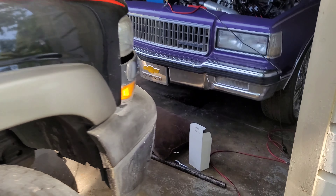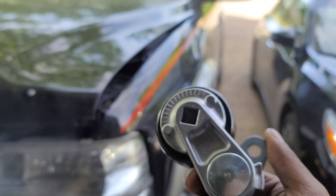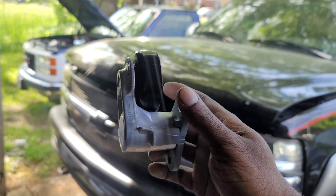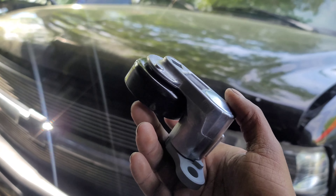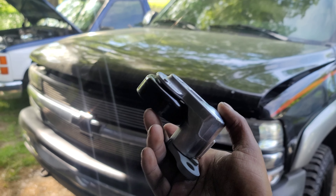Now I have to do the AC on this other truck. The pulley on it was messed up — whoever owned it before me must have had that problem — so I had to go buy an AC tensioner pulley yesterday. The belt is already on there; I did it yesterday but didn't record it. I'm gonna put this on, put the belt on, and since my guy's not around to vacuum it down, I'm just gonna go ahead and put some Freon in it and see what I come up with. I've done that before on a vehicle.